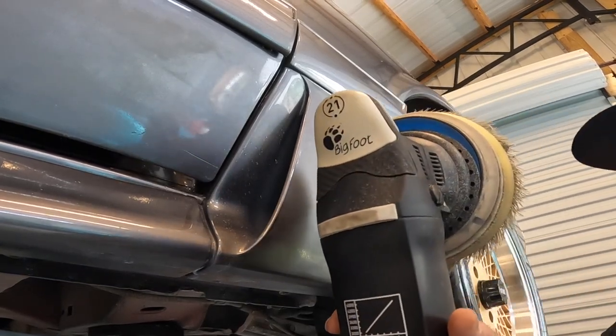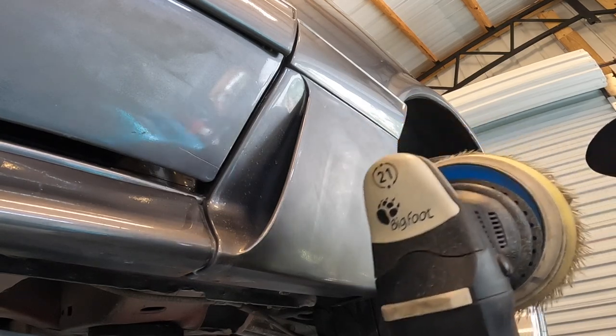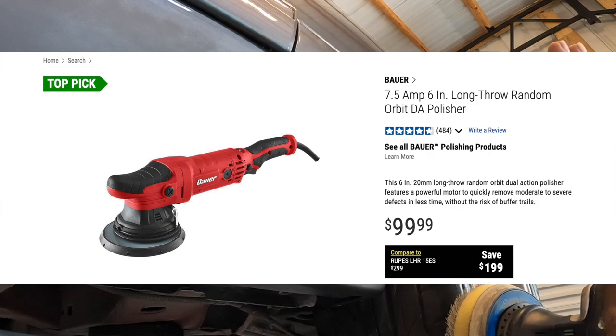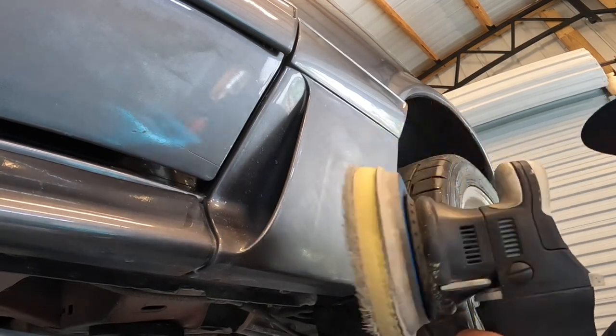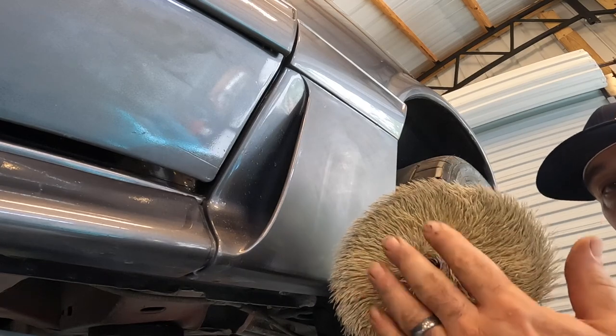Listen to me, you do not have to have this. You can go to Harbor Freight and get a random orbital. You can use a high-speed buffer, a rotary buffer that just spins. I don't recommend you guys use that unless you already know what you're doing. If you already know what you're doing, you're not watching this video to learn anything anyway. So start out with a random orbital and you'll be good, okay? And it does cut quick.